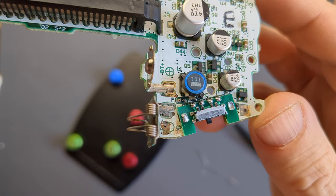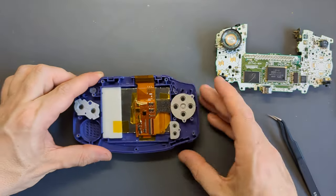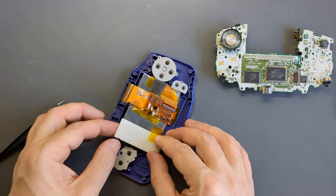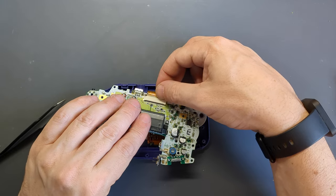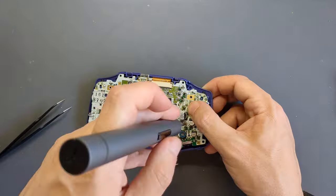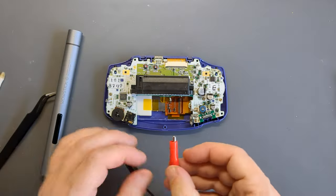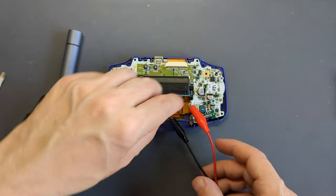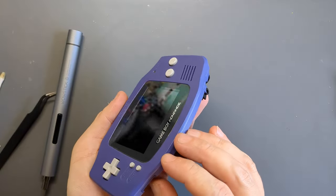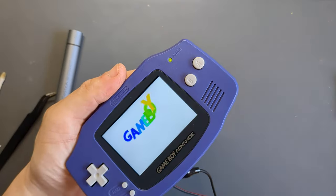After this, a visual inspection should be enough to see if it's connected properly. I decided a continuity check with a multimeter would be a bit fiddly at this point, so I just went ahead and did a partial reassembly for testing instead. Before putting the motherboard back on, I got into the display area to remove a little bit of debris that had got in front of my IPS screen — well worth doing when your console is open. I reattached the ribbon cable to the motherboard, being careful to clip down both sides securely, then put the motherboard in place and reinserted the three short Phillips head screws. To test, I used my USB testing clips from Zed Labs — you just plug it into a power source, connect the red clip to the positive battery terminal and the black one to the negative, and then it's safe to try out the switch, which thankfully worked perfectly first try.